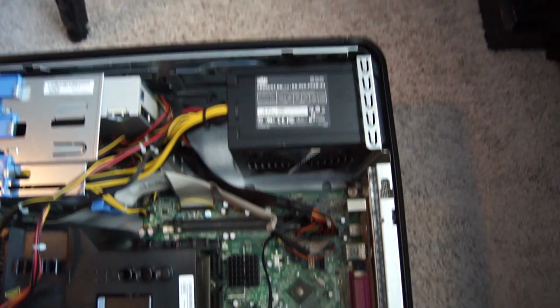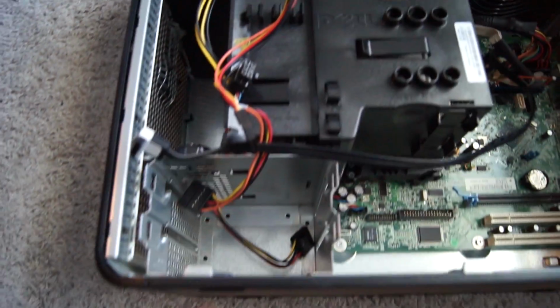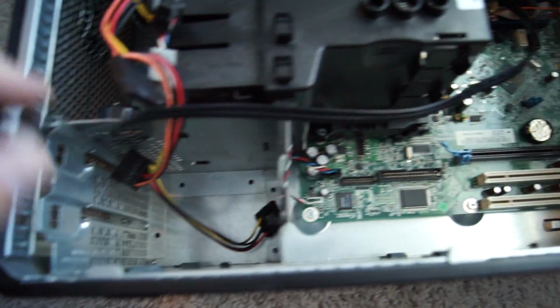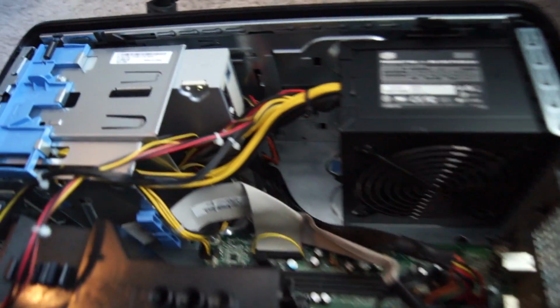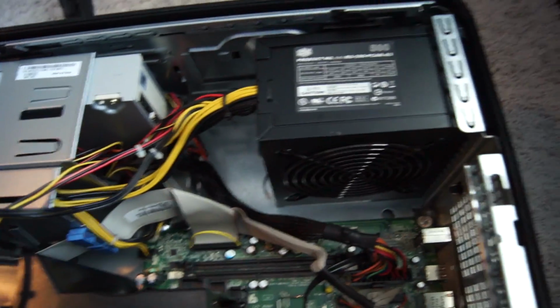The second issue was the PCIe slot only pumps out 25 watts, so any gaming GPU that uses PCIe slot power only won't work. I thought about grabbing a GT 1030, but they do use up to 35 watts, and so I figured it might throttle, it might power limit, but I'm glad I didn't get one, and you'll see why later.